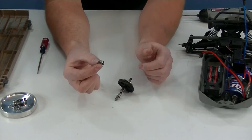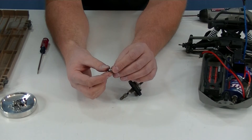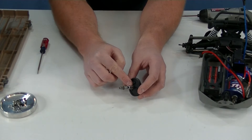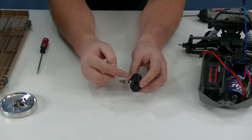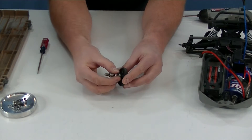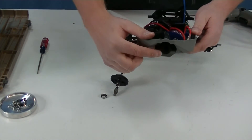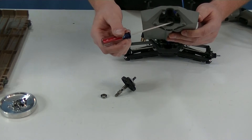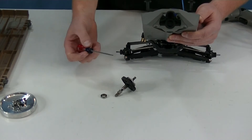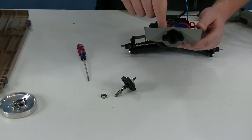Now, this one's not bad, but I'm doing preventative maintenance because we can upgrade it. We're going to put a better setup here to help keep this from happening. This will seize to this — after the plastic bushing melts, I've seen all kinds of problems. Once it melts, the seized bearing will actually freeze right to it, and then it starts spinning the bearing inside the bulkhead, melting around the bulkhead housing. Your bearing will move in the plastic as it heats up, it doesn't fit right, and you're stripping bearings. If you've had that problem, you're going to have to change this bulkhead assembly also.